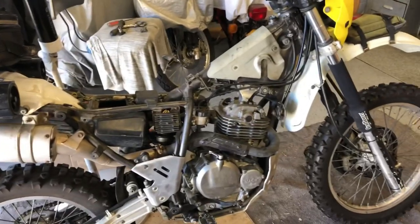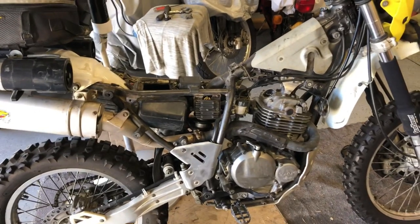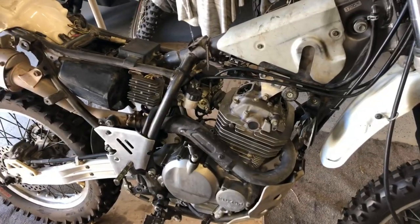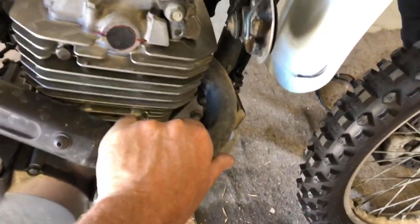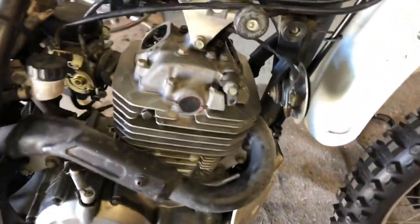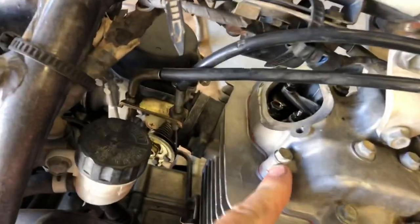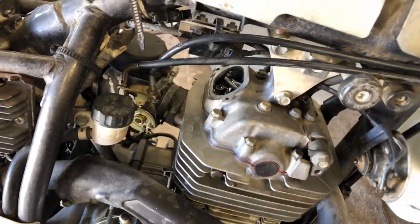As a disclaimer, your best bet is to check valves when the bike is cold — drive it home, park it in the garage overnight, check it the next morning, or even if it's been sitting a couple hours. You're going to get the most accurate reading. We just ran this and it's only been sitting for 30 minutes. It's not hot — the exhaust isn't hot actually. You're not going to get 100% accurate readings, but our exhaust valves are pretty good. The intakes are way out — they're pretty loose.